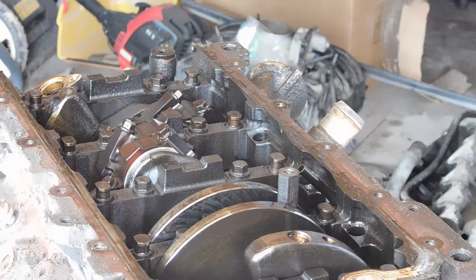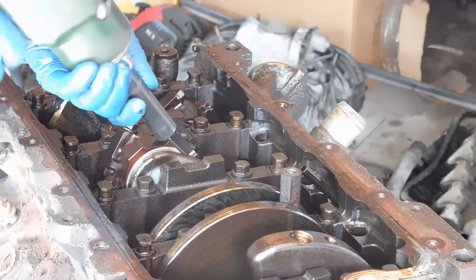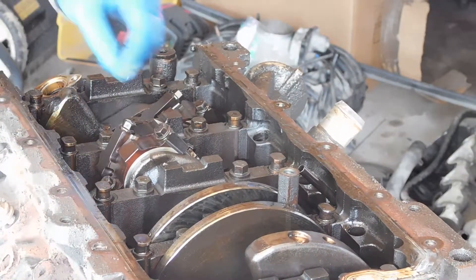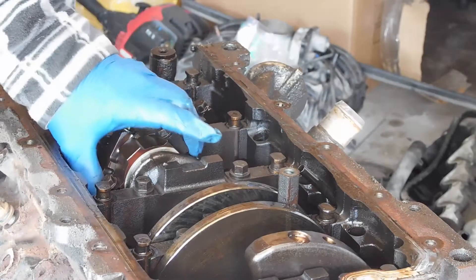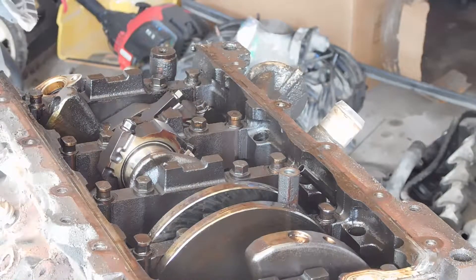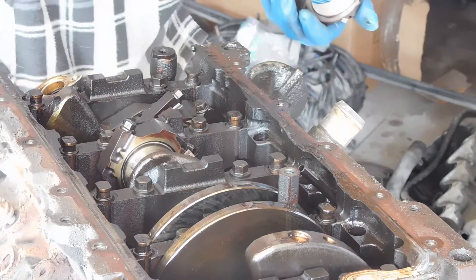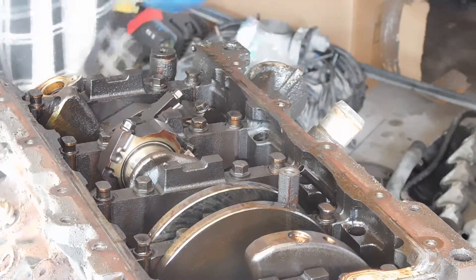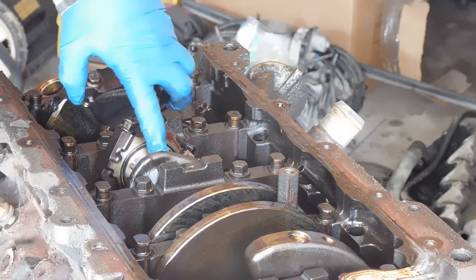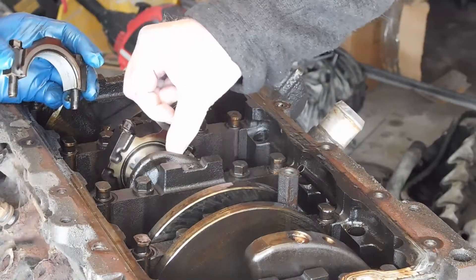11mm, for all you kids at home. Just all the metal starts circulating throughout that motor. I've seen worse though. But that metal shavings in there — see that lip on the side? That lip tells you how much metal's been eaten off.